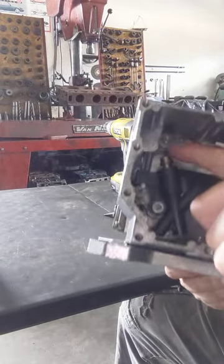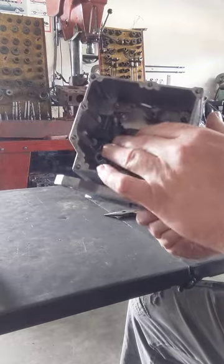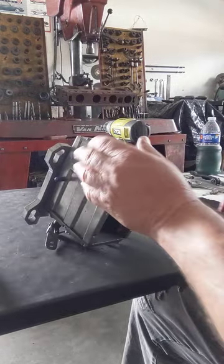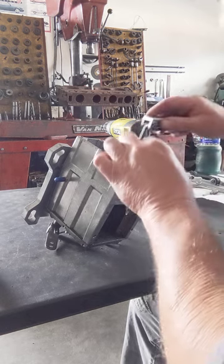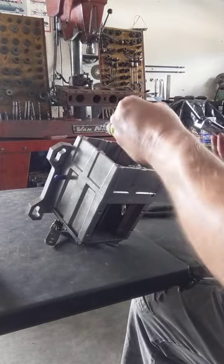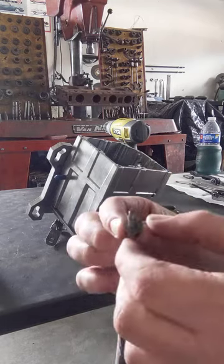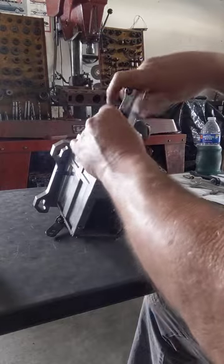Now, that's what you got. Without the cam in there, see, you have this. All that does is move this guy up and down. That's basically it. All right, but now we'll go ahead and remove this. So, let's see, one of these. Right there. These are like a little shoulder bolt, because that spool has to move because it's hooked to the idle mixer screw, and I'll kind of show all that. See, it's a little shoulder looking bolt with a steel washer. But when we go through the reassembly of the carburetor, I'll actually start talking more about all that stuff.